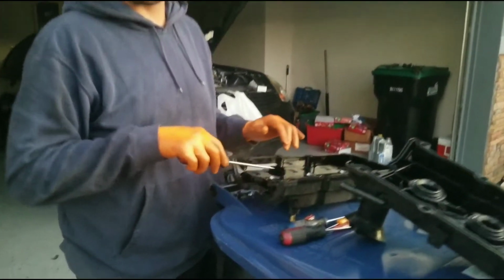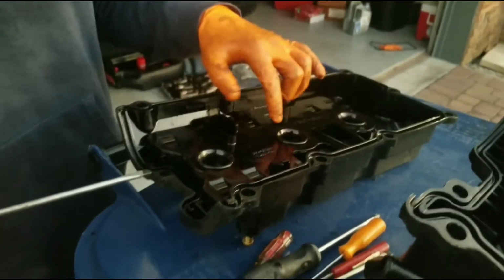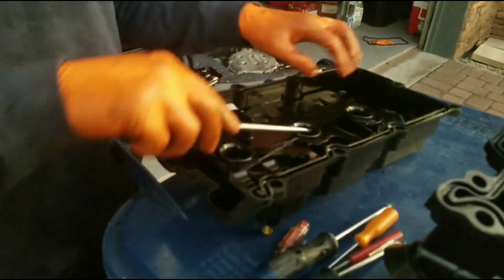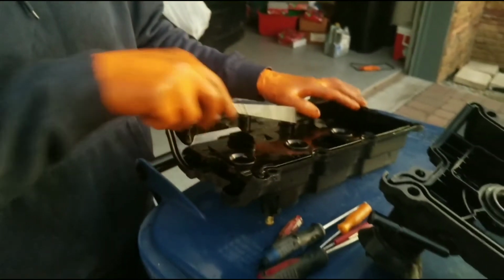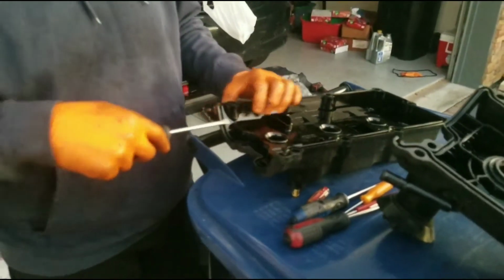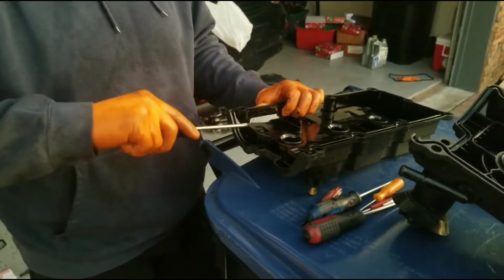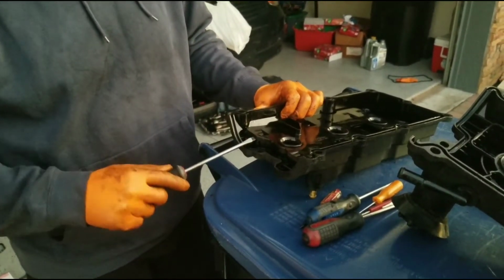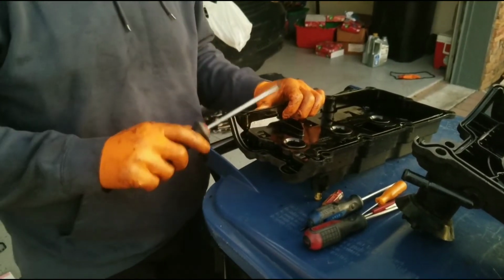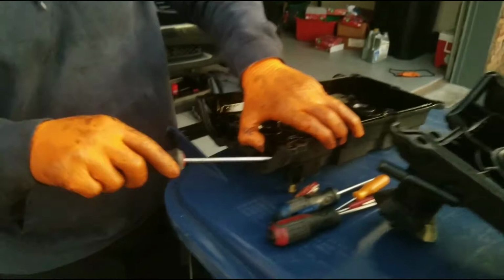How you're gonna pry around it, so you can get this plastic cover off the baffle, where it's holding back the spark plug tube seal. So you grab a corner, you see, and little by little, easy, you start prying up. All that cracking you hear is the glue. Of course, don't just grab and pry hard, because you might potentially break the plastic. So find a way.